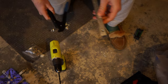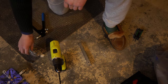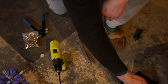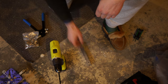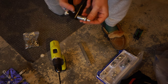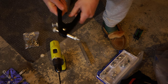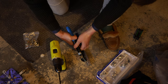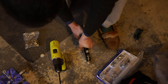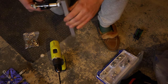I've decided to use rib nuts to secure any interior storage compartments or anything else I'll be fastening to the walls or ceilings. I have these zinc-plated rib nuts on hand from a previous project, and I bought this rib nut gun off Amazon. So I've drilled my hole, got my M5 mandrel on there, you screw that on top, put it in the hole, apply pressure downwards into the hole and then squeeze — and that pulls it up into the material. Then you just unscrew it.